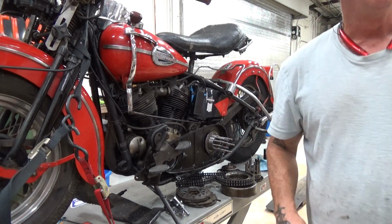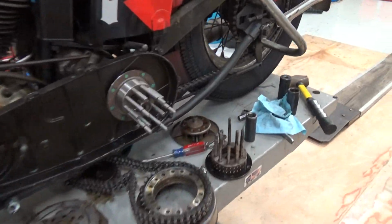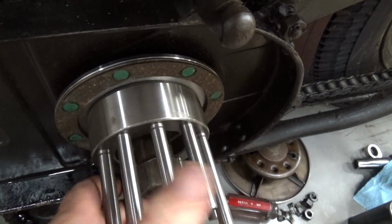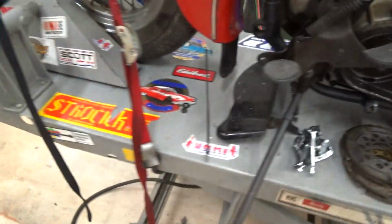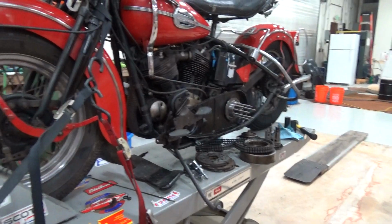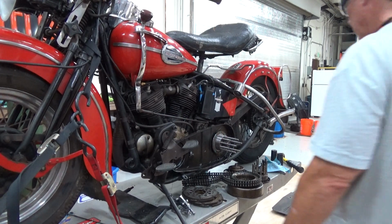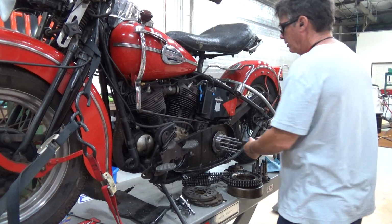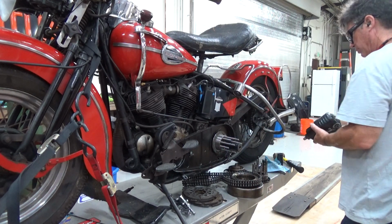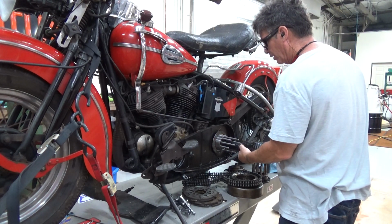Okay, that's impacted. It's not set up to run, I didn't put a keyway on it, but it's impacted in place. And as you see, it has all the clearance you need, buddy. So, they are made correct. So that way when you get your aftermarket clutch hub and you go to replace your stock one, you're good. Right? If two real knowledgeable guys question me on it, this video needs to be made just so everybody knows. End of discussion.